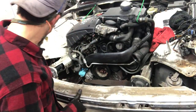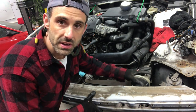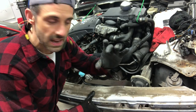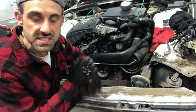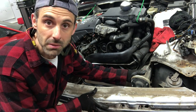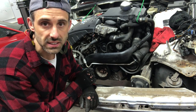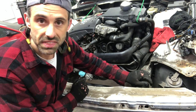Loosely mounted here, and the problem is that even though I've widened the frame rails themselves — and I can always beef it up with more weld and metal — it's the shocks. The diameter of the shocks from the driver's side to the passenger's side is still less than 28.5 inches. That's going to be a big problem for fitting the radiator in there, so I have to figure out how to widen the distance between those two shocks on the back side of the radiator bracket. And I think I know how to do it.